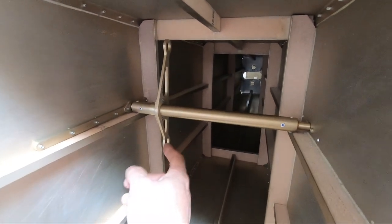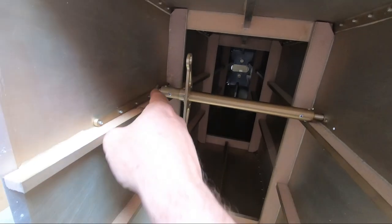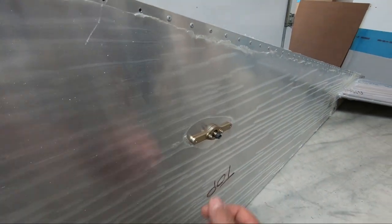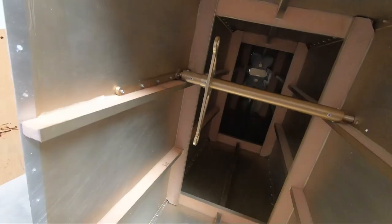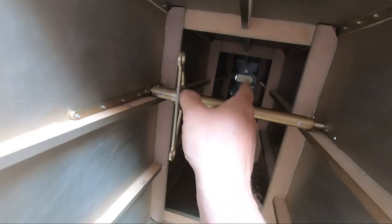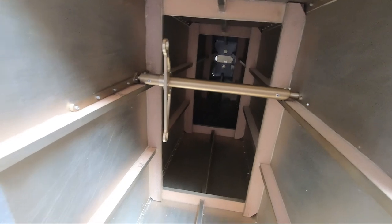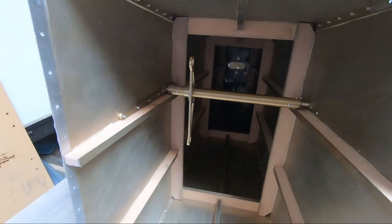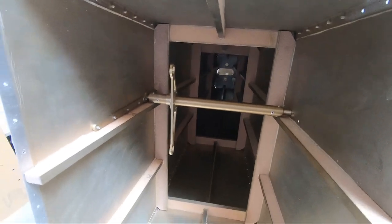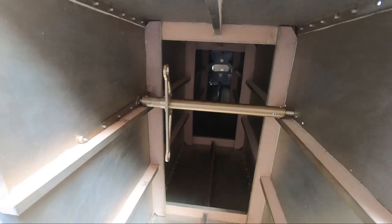I still have to put the bearings inside this control horn for the two control rods that connect to it. Once I get those bearings in and fix these two little things, I'm going to mount this permanently with the screws on the outside and screw down the self-locking nuts on top. There's no reason for it to come out again. Then we're going to start working on finishing up some things in the tail. I want to see if I can get the control rod that goes from here to the tail completed before I install the tail, but I'm having some issues getting hardware — there seem to be shortages all over the place not only with rivets but bolts.